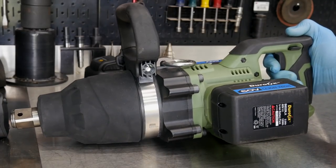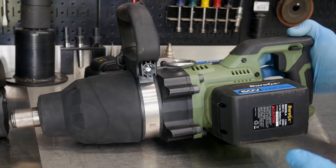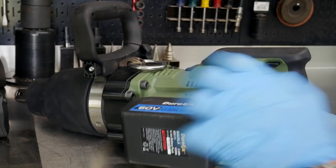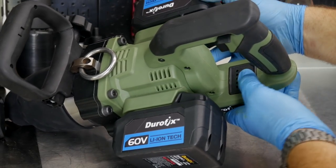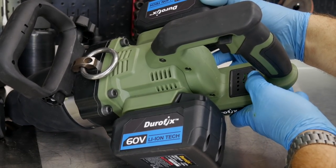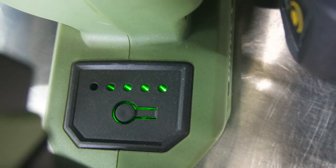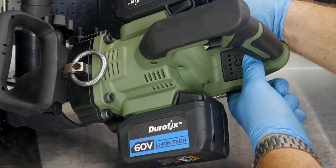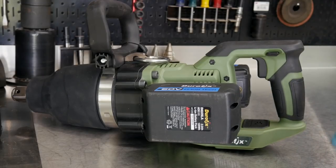You'll also see from my trigger finger here, I can go really slow. You can speed it up, so you can control a lot of that power from your finger regardless of what mode you're in. Right here on the mode switch or the speed switch, we can select whether we want mode one, two, three, or four. And mode five is when all four of the lights light up — that's max output, and modes one through four have that auto-stop feature.